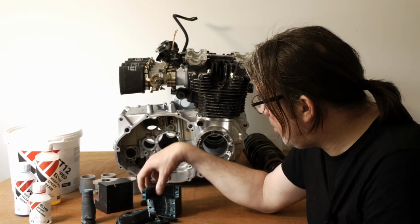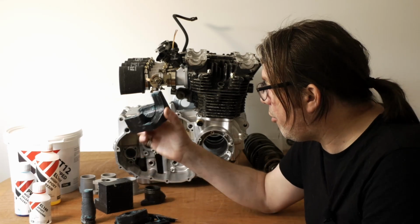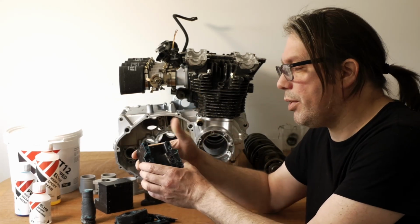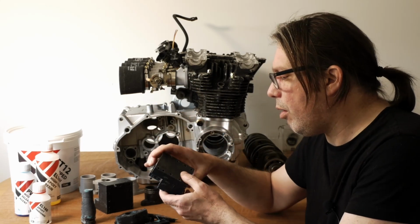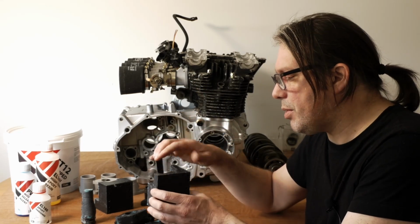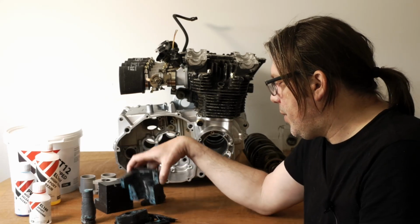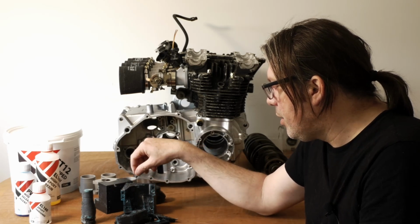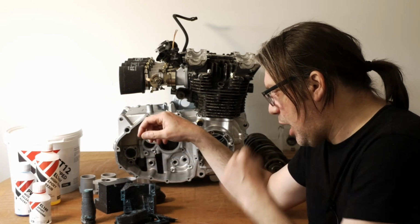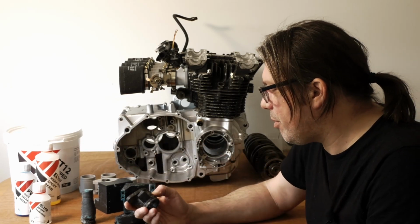But in the end, I think it was too much carbon, because it actually bulged out in some places where it compressed the mold. And I didn't go with a huge amount of infill. I only went with 50% infill, but the gyroid infill is quite sturdy. And to be honest, this is already half a kilo of 3D printer filament, so I didn't really want to have to use more than that. So I could probably have used a higher level of infill to prevent that. But I think the reason it happened wasn't necessarily because the mold was wrong. I think it was just because there was too much carbon fiber in there.